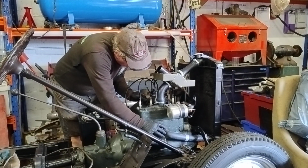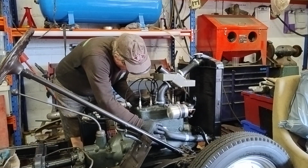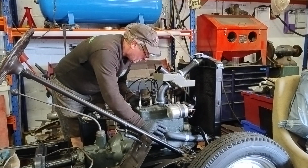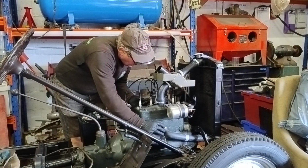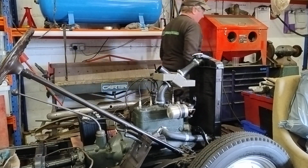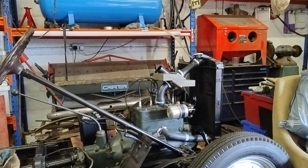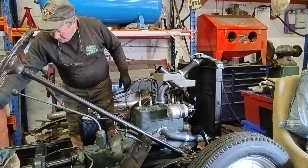Trying. Tell you what, I'll get a touch of brake cleaner there, see if she can. I can hear the starter clanking in and out a bit. Just get a little sniff. She's going to go, obviously. It might just be a touch out of time, but you can all see what it's like, real, in a workshop. Let's see what happens.